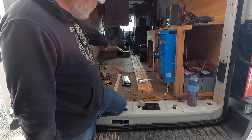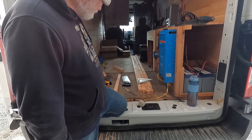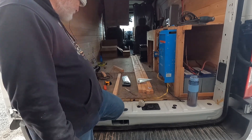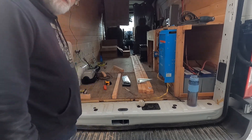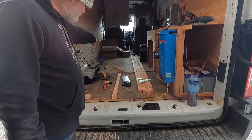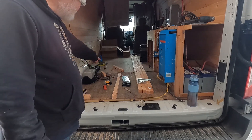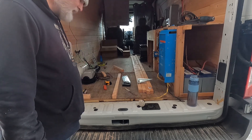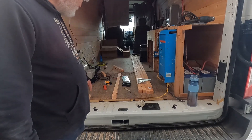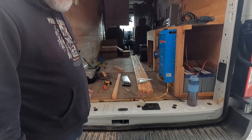Basically I'm going to come 16 inches out this way — it'll actually end up being probably 17 and a half by the time it's all done. I'm making my initial cuts on these boards at 16 inches, so I've got 16 inches here, another 16 inches that's going to go up there, and then that small board is a nine-and-a-half-inch cut because that's going to be pressed up against the fender well, which loses about six and a half inches to the actual wall. And I'm going to have another strip connecting all three for the outer border, about 70 inches long.